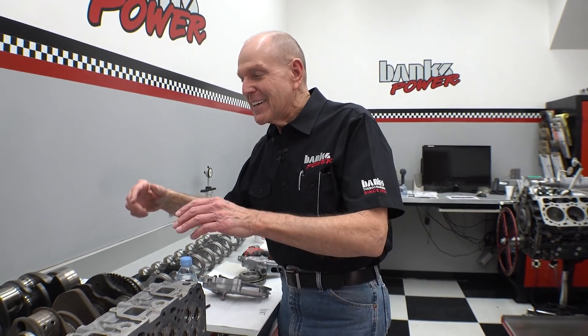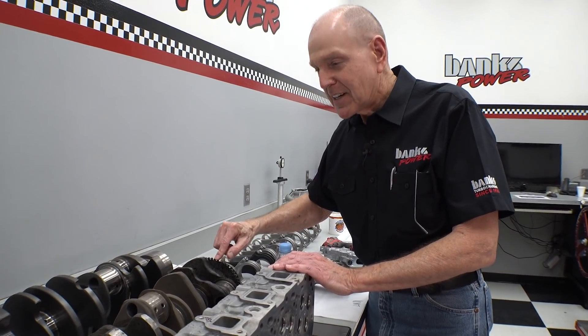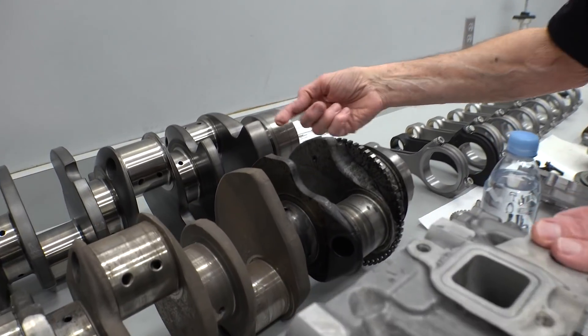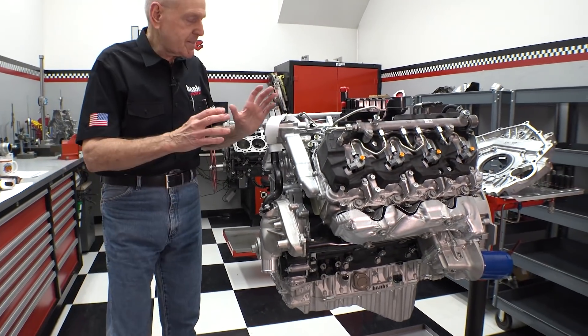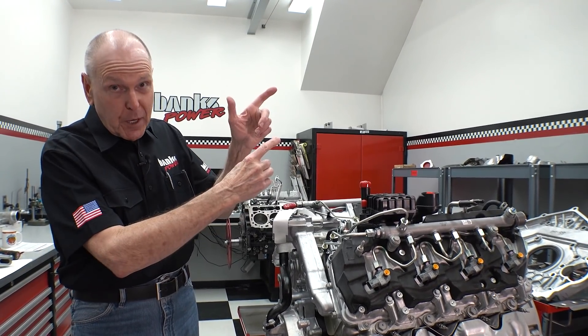What I've got to do with these cranks is — the timing wheel for crank position on an L5P is at the back of the crankshaft. I'm going to take some of these billets and machine the back end of this counterweight to put it there. This thing will become a very serious racing engine and might be the first really built L5P on the planet. I hope so. If you want to see all my lunacy as it happens, subscribe right here on YouTube.